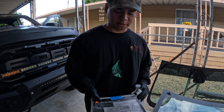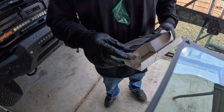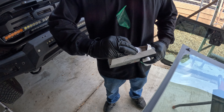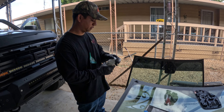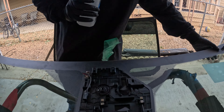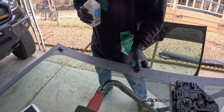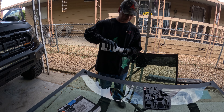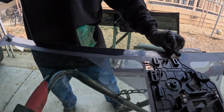So we prepped the glass using the Sika power clean aid. What it really is — it's like sponges, like Mr. Clean. Sika sells their own solvent to clean, but we like to use alcohol. If you check out these fingerprints on top from the grease of fingers from the warehouses — we gotta clean this off really good, otherwise the urethane won't adhere all the way. So we just get a little alcohol on the power aid and give it a few good scrubs.